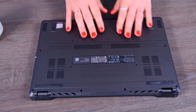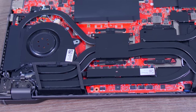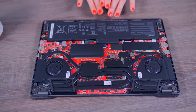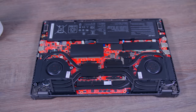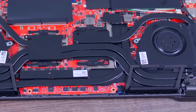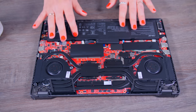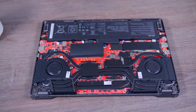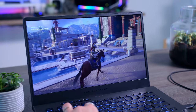It is not hard to clean, repair, or upgrade the G14 — just remove the 14 screws from the bottom and you have access to most components. You can clean the fans, replace the battery, replace the SSD, and replace the Wi-Fi chip which is hidden under the SSD. Unlike the G15, you can't really add a second SSD, which makes sense as space is a limiting factor. Unfortunately, half of the memory is soldered on the back of the motherboard, so technically you can still upgrade one DIMM, but it's unclear how that will affect overall performance.